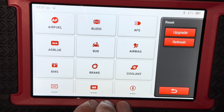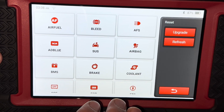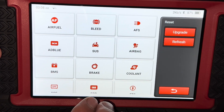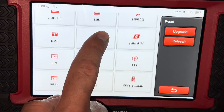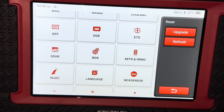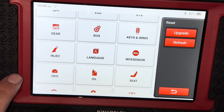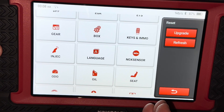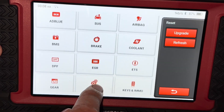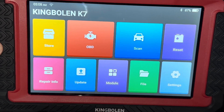As you can see, this scanner is absolutely loaded and packed with features and capabilities. I've gone over just some of the main ones — it would take days of video to go through every single feature and sub-menu. Just a quick note: just because a feature is on the screen does not mean it will be compatible with your vehicle. For example, fuel injector coding — I have a 2017 Chevy Equinox, and my specific vehicle does not allow the injectors to be coded. But BMWs and Audis often will allow that. Remember: your vehicle may not allow some features — it's not because the scanner isn't capable, it's because your vehicle isn't capable.